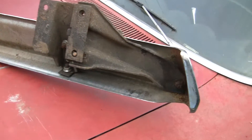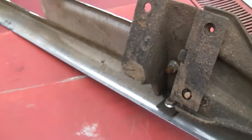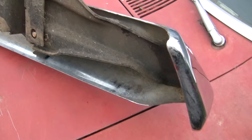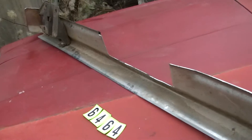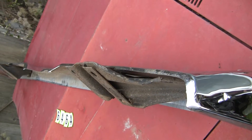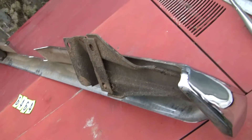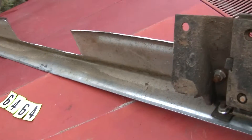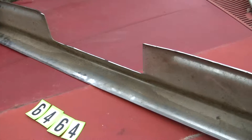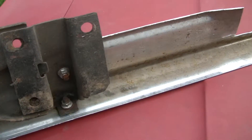Now I want to tell you about what I've noticed about this bumper — it's got some new nuts on it. Here's what I've noticed: this bumper has been straightened. When it was chromed it was straightened, but the chromer obviously didn't know too much about 70/71s. He has made it completely straight, and if you are a knowledgeable person about 70/71s you will know that 70/71s have a slight curve in the back of them. So this bumper, right in this area, kind of pinches up to the body — it doesn't fit like a factory bumper. But it is a nice bumper.